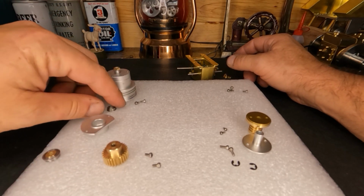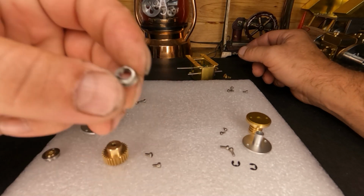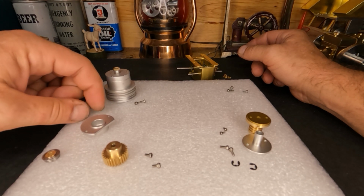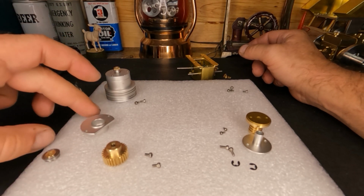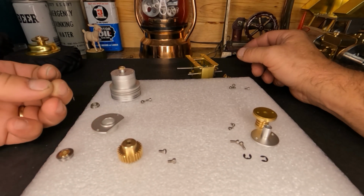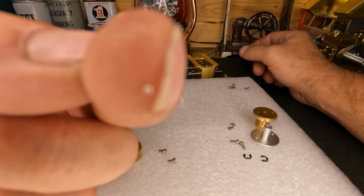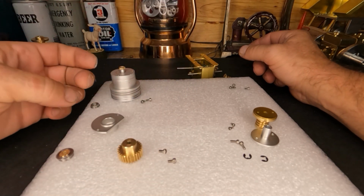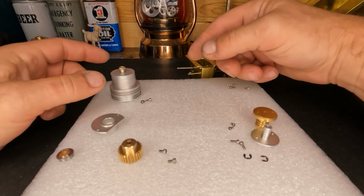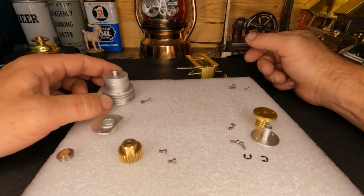So, this is our bad bearing, and I'll show you. Let me see if I can get one of these. There's one laying right here, and it's so small. I wanted to show you guys how small these ball bearings were. See that little speck right there on the end of my finger? That's how small these balls are in this ball bearing. And that was our click when we'd push this in and out. It was riding over the race.